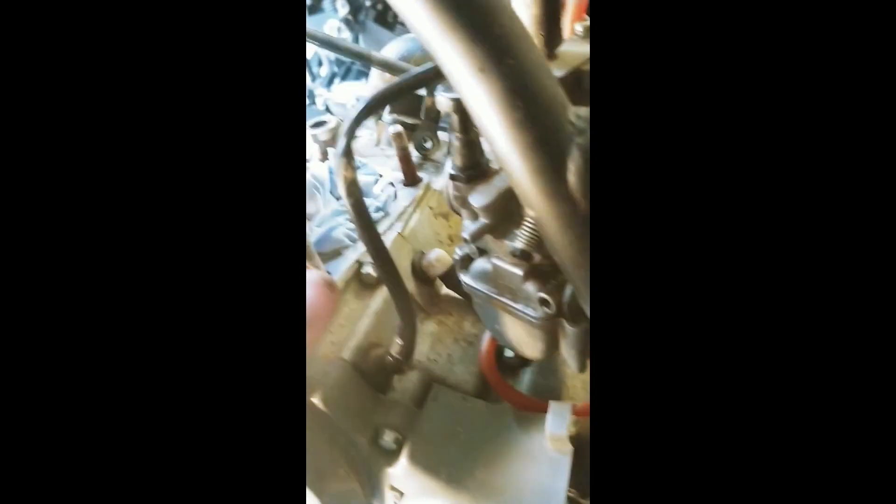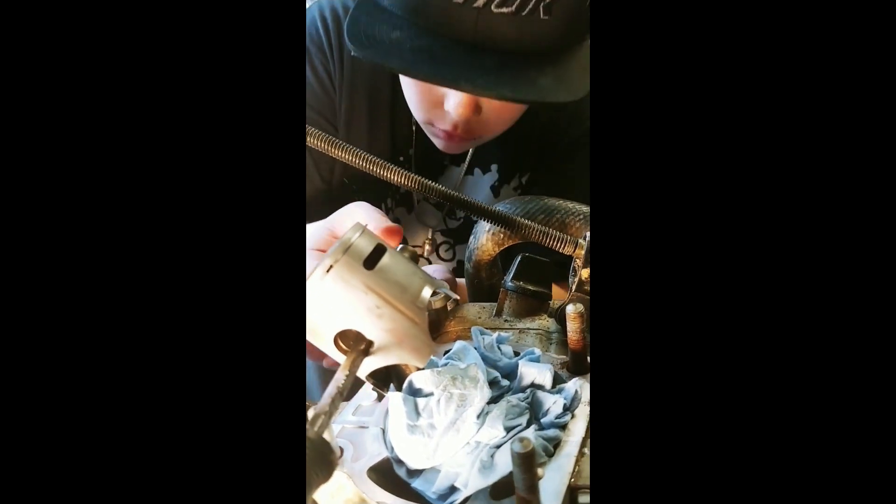There's a little clip inside the wrist pin — you may need your dad for this. It's always smart to put some paper towels inside the motor so you don't drop anything in there. Go to the other side. I'll tap this wrist pin out to you.